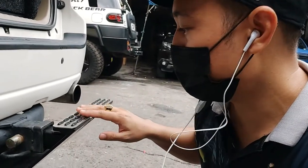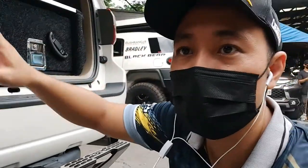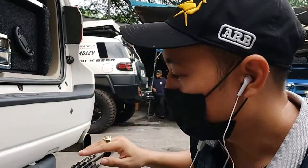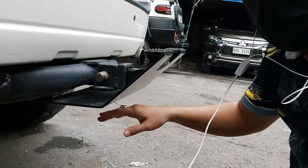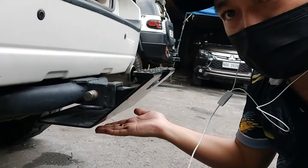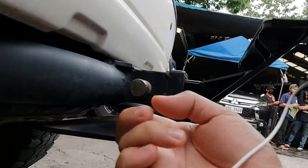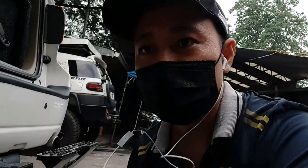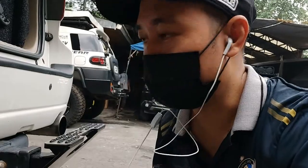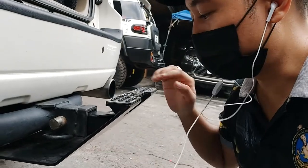The Body Armor Backbone is not only a step that allows you to get up and gain access to the back of your rig — it also acts as a skid plate. Whenever you come down hard off of obstacles, this is the first thing that will impact the ground. My tow hitch already has a lot of dents, and I have tons of scratches here because when I land on obstacles, the back of my rig really contacts the ground.